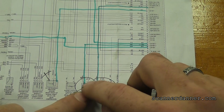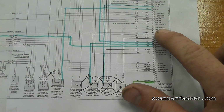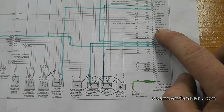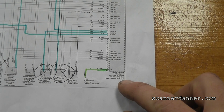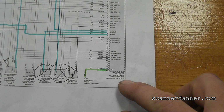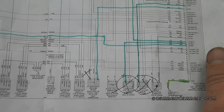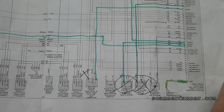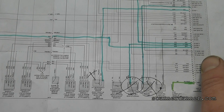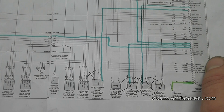It says low reference. Right here, crank sensor signal is right there. So it's a 3-wire sensor, it's a Hall effect, digital signal. And all 3 wires go to what? What is this component? My engine computer. That should be where I'm getting RPM from. Is it going to be worth checking that signal? I said no because we had a crank RPM, but could it be substituted from the cam? I don't know. We're getting a crank reference code, which according to the flowchart on the scan tool is what? Wiring, sensor or computer. Isn't that pretty much our only options with the 335 code? Do you remember?